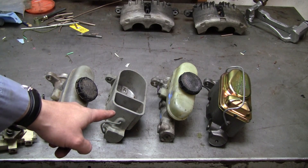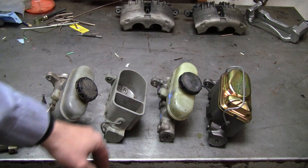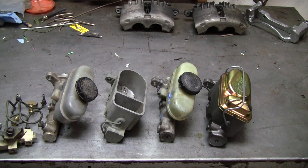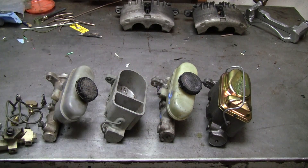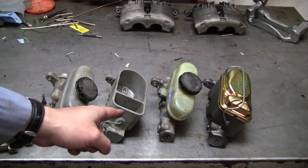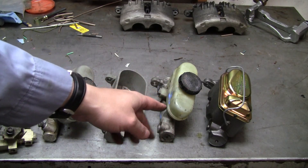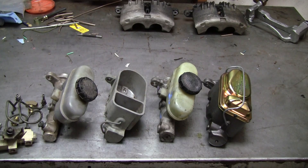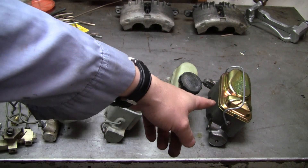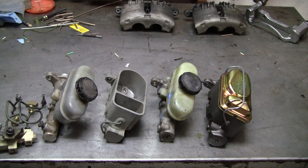If you need a one-inch bore, you have two choices: go with this Lincoln Town Car (85, one-inch bore, two ports), or go with the 93 Cobra, which looks almost identical to the 94-95 GT/V6 but has a one-inch bore. For one and one-sixteenth, go with the 94-95 GT or V6 master cylinder — these are extremely cheap, available used, rebuilt, or brand new, easy to find. If you want bigger than that, you'd go with the SVO — that's the big one. Most calipers won't need to push that much fluid, but there are definitely applications where it can be used.